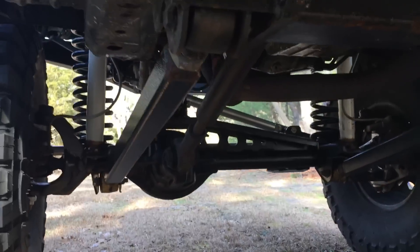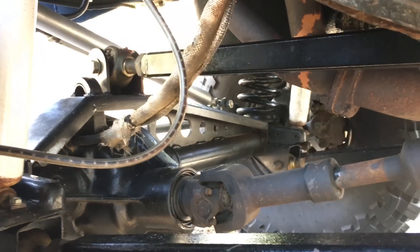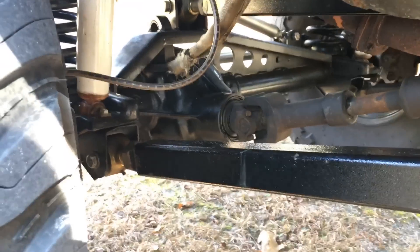I'm just giving you a close up of the way the crossmember is mounted to the unibody with welding. It's 2 lower long arms with 1 upper, so it's a true 3-link kit. The upper arm goes all the way back to the crossmember as well as the 2 lowers.